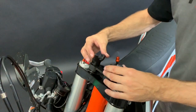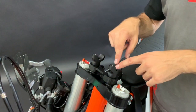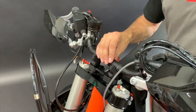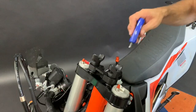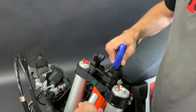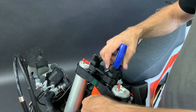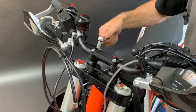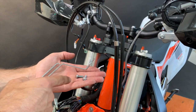When tightening the handlebar clamps they could rotate, so it's not easy to align them correctly. Don't super-tighten yet — do the alignment first. The trick is to put the Allen bolt from the top, hold it, and tighten the bottom nut. This way the upper clamp shouldn't rotate. Now mount back the handlebars, take the hose guide and M6 by 16 bolts with a flat head.